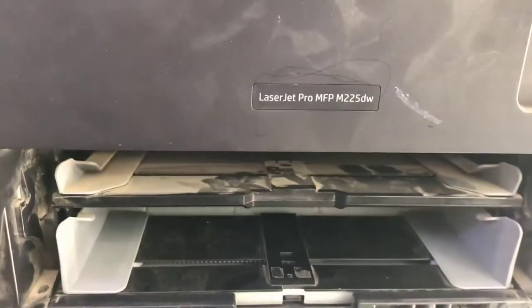Welcome to Smart Tech Guys. I have a printer over here - HP LaserJet Pro. The issue is the sleeve is damaged. We will open the fuser unit, disassemble it, and change the sleeve, then return the fuser unit back. So here we go - let's see the model number and the steps.